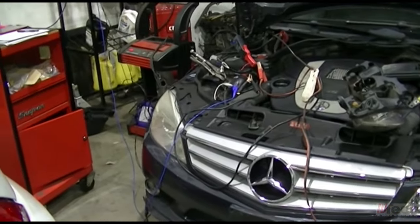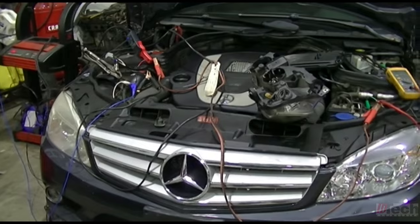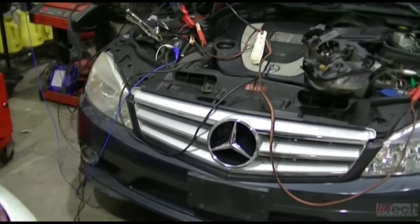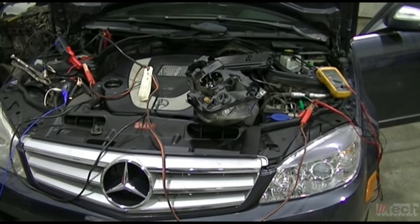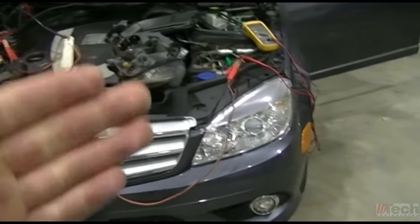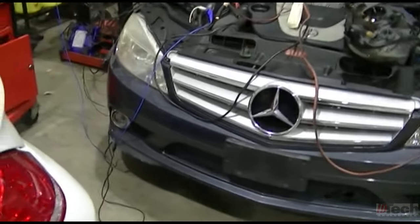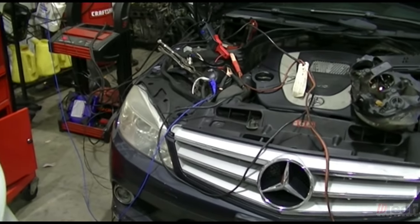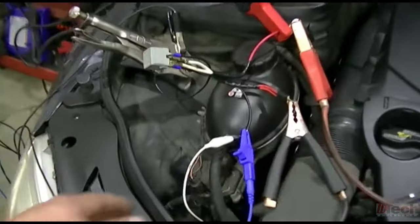We know the amperage levels are okay. Nothing crazy is going on as far as electrical danger or issues. We are being controlled by a module, so we know what can happen if an electrical issue were to happen. You basically blow, looks like, the driver for the headlight control anyways. But even at this point, I know we are not creating any issue. We're not creating any higher amperage draw on that side. None of our wires are getting hot, and obviously they won't, because we can see the numbers and nothing is going in a bad range.